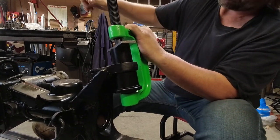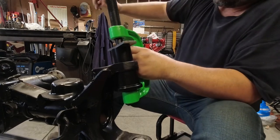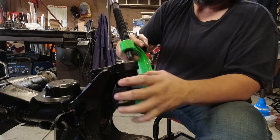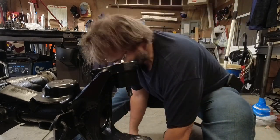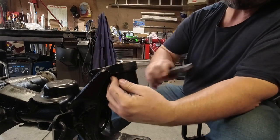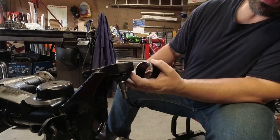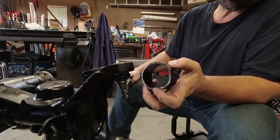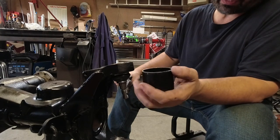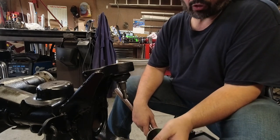I think once it's started, I think it'll be okay. And even at that, it wanted to, and that cup is marginally stuck. Okay, I got the cup off. It's all the way up in there. So if you gotta do this, you have to find a kit made for a 2018 and above JL or JT ball joint. The cups need to be just a little bit smaller. And all the adapters I could find that they sell, none of those was gonna work.